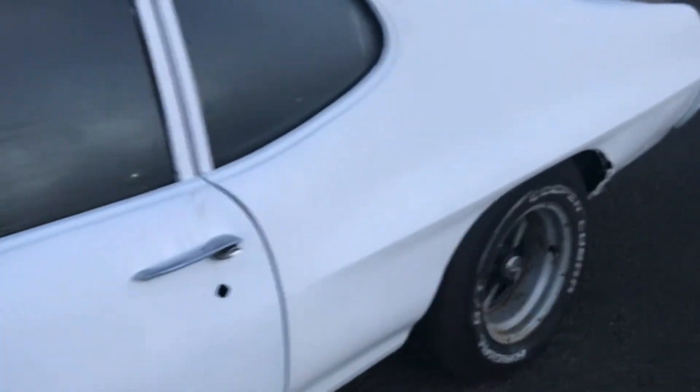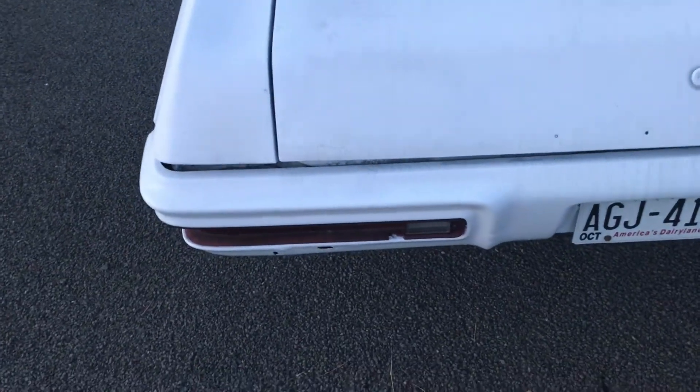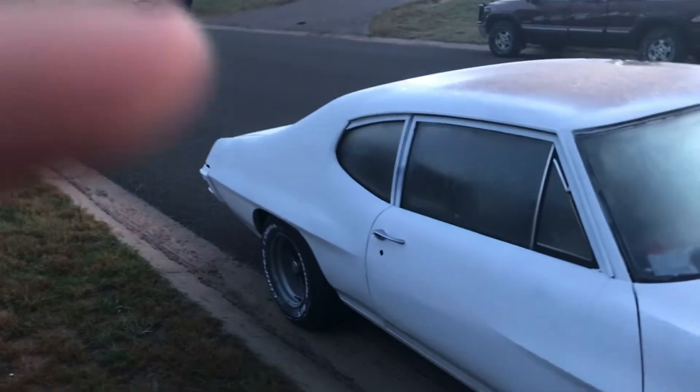The only runs are — I think it's in this door. Maybe it's on the other side. There's a hole right here that I fixed with Bondo, aluminum tape, fiberglass, more Bondo. There are more stains on the back — it's cool, I don't know how it happened but it's awesome. Oh, the runs are on this side. Once I got the spray can a little further away and figured out how to do it, those are about the only ones I got. Maybe I can wet sand that and kind of bring them down a little bit.